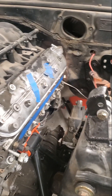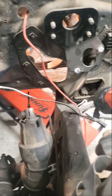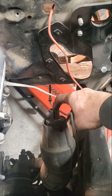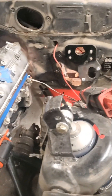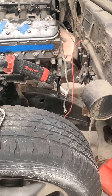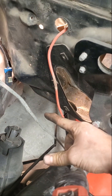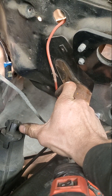In the early planning phase of this project, I had intended to maybe run just a shorter steering column. If you noticed in previous videos, there's only about an inch between the rack and pinion and the stock steering column rag joint, and I couldn't quite figure out how to make that work. So I was looking at spending two or three hundred bucks for a steering column from Speedway Auto or Summit or Jags - a universal job that was maybe a couple inches shorter, so that instead of sticking out two or three inches it would be closer to flush with the firewall, possibly giving me enough room for a lash up.